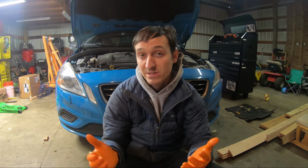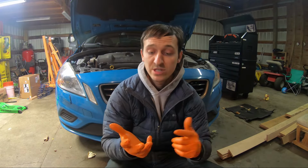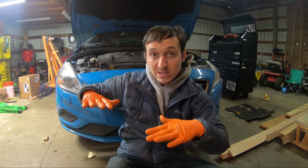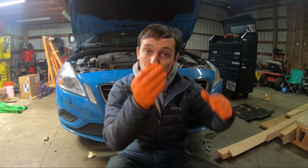So even if you don't have a scan tool, and you don't have the money to go do the transmission oil change and want to do it at home, and you don't have a scan tool to even check the fluid or do the counter reset, just go and drive your car, I would say at least 2 miles, come back home, raise your car up, put it in park while it's running, pull the level plug and let it drip out the same way.